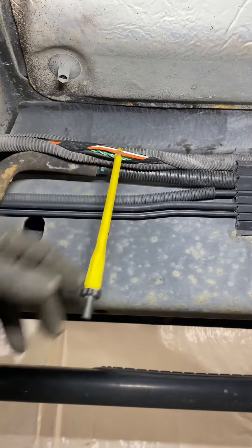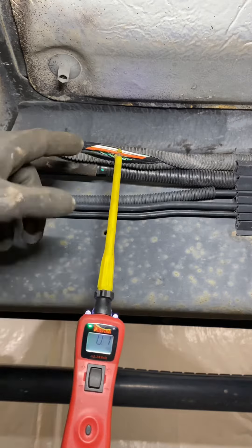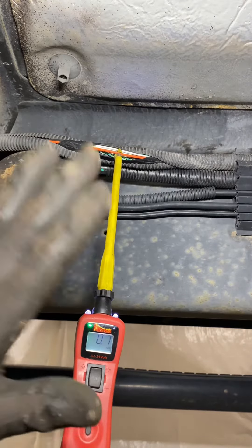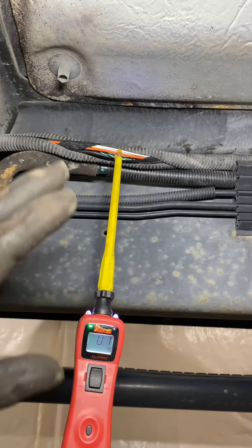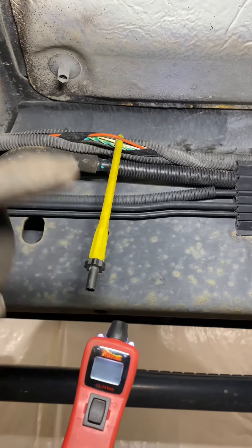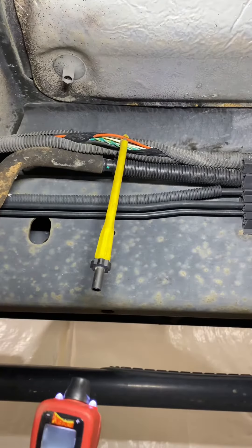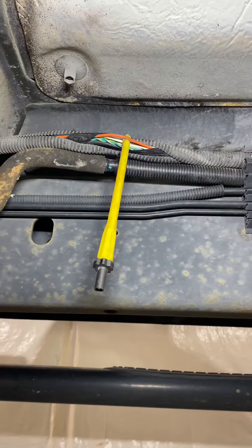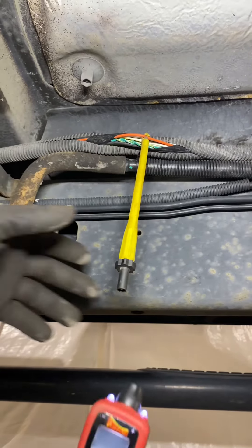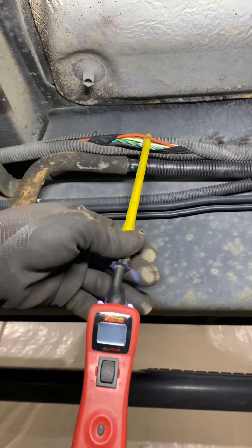I'm going to tap into this wire right here using my handy dandy tool. When I'm done I'll put a little RTV in that little hole so we won't have any corrosion. I use my power probe here — fits right in. I'm getting ground, that is fine. Now I'm going to cycle the key to see if it gets power when cranking. That way I know everything is good up front going all the way back to the fuel tank. There could be corrosion right on top of the fuel pump itself, but chances of that are slim.